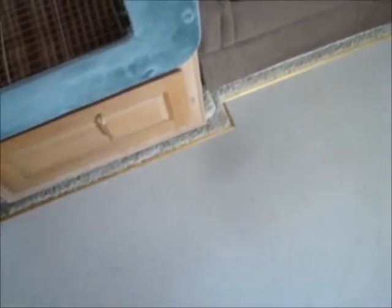In here is where we stopped it, and I put that gold nap lock there to stop that carpet. For the bathroom, it goes to sheet linoleum, so I put a piece of metal there for that where you can see the cuts. So it's all looking pretty good — there's a nap lock all along there. The slide-out comes in this way and covers the floor when you're traveling. But this is it with the slide-out all the way out.